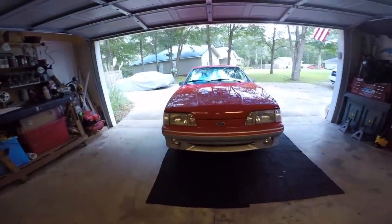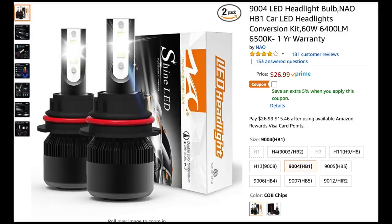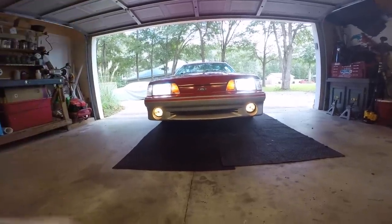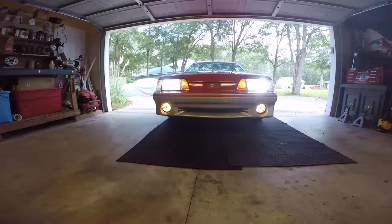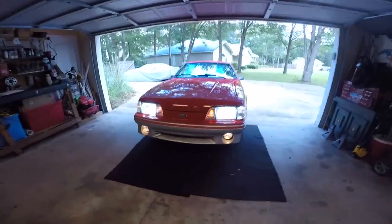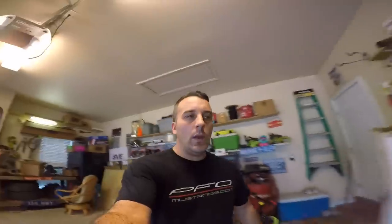First off, let's talk about what we've got. We have LED headlights in the front of the car — I got those from Amazon for about 26 bucks. Down here for the fog lights, they're aftermarket fog lights but they have the stock bulbs in them. The top lights are really white and the bottom fog lights are really orange. I like the difference — it reminds me of the old four-eyed cars with the yellow lights. But I understand a lot of people want LEDs in the bottom. Be warned though: the LEDs I've purchased don't give off a lot of light. If you're putting LEDs in your car you probably already have LED headlights, so the fog lights don't help much anyway — they're going to be completely overpowered. As long as you have LEDs up top, you'll be just fine doing LEDs in the bottom.